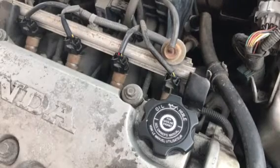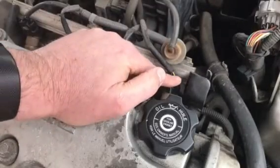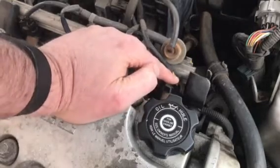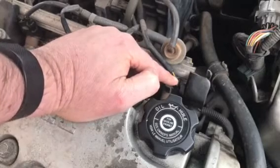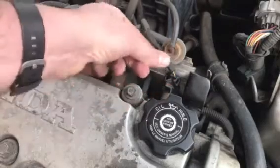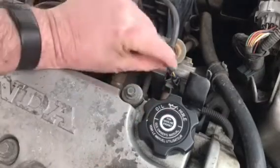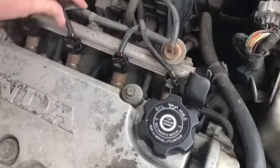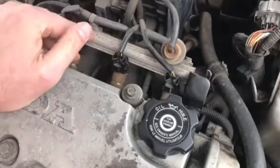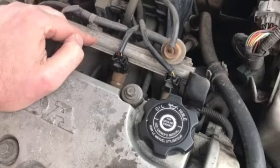So what I'm going to do - first things first - you've got two wires. There's different colour wires. It's got an earth wire, ground wire, which is yellow and black on this Honda. So that's what I would check first, make sure it's got a good ground. And then it's got the signal wire - it's got a red, or like a brown-red, blue and yellow. So it'd be good if you could get a wiring diagram as well, but those are the wires you need to be chasing back through the circuits.